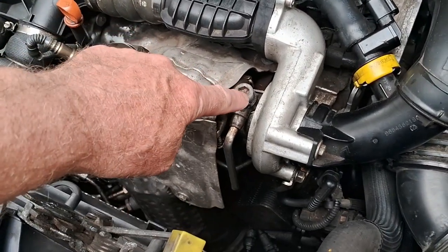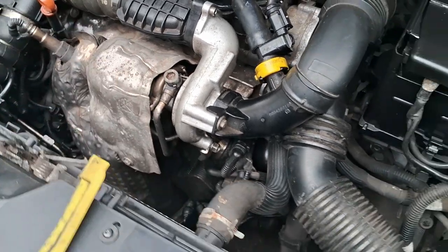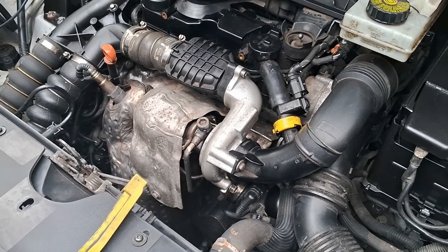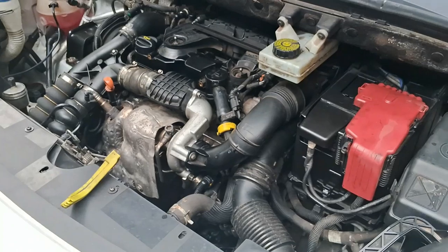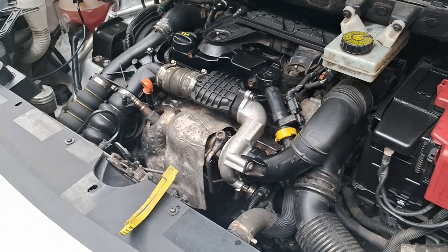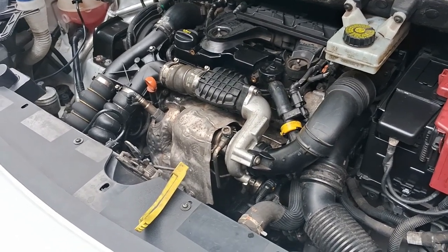So that's where the oil goes into the turbo and it just wasn't getting enough oil to the bearing. It's getting plenty of oil now, there's no whine, and I feel a lot happier with the engine. So a good modification to take that little filter out, and you can't beat a good flush on a diesel engine.